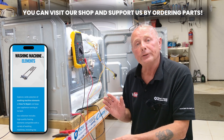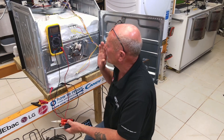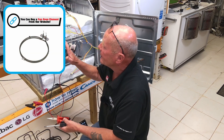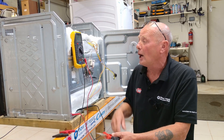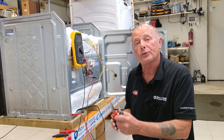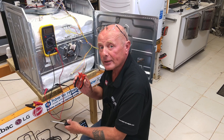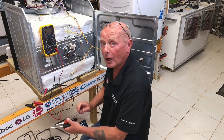The first thing you will need to do is remove the cooker from the housing if it is built in. Then you'll need to remove the panels to give you access to the element. Then you will need a multimeter — it does not need to be an expensive one, a cheap one will suffice. It only needs to be able to read voltage, an ohms reading, and continuity. You will need a Phillips screwdriver on most cookers, and I do advise using a set of needle-nose pliers because when removing the wires some of these edges are quite sharp.